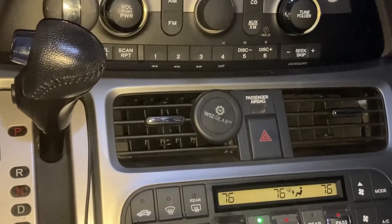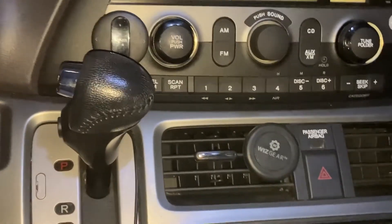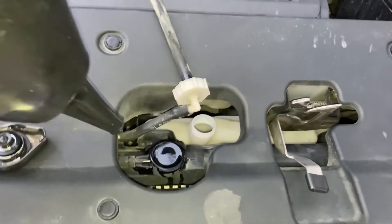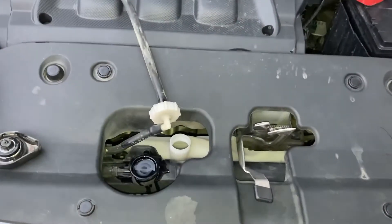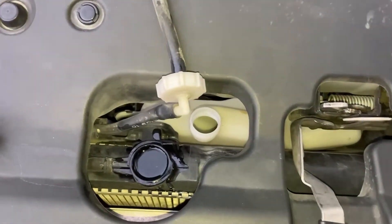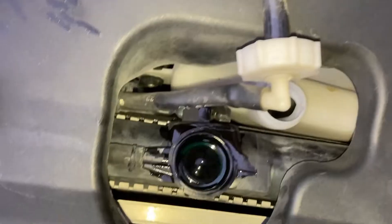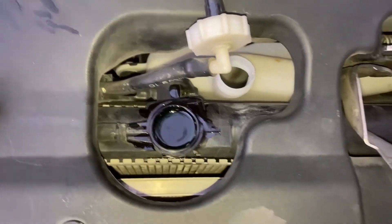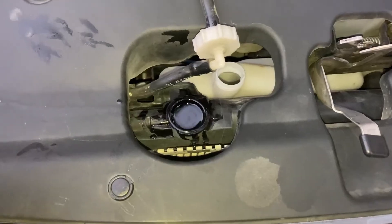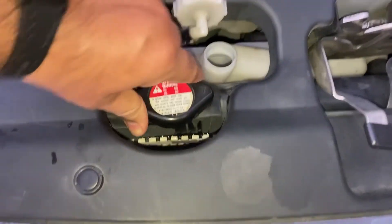Inside the vehicle I'm going to turn on the heat. You want the radiator fan to kick in. When I say burp the system, what I mean is: while the car is running, grab the radiator hose and press on it, and as I'm doing that we'll see the air bubbles come out. We'll do that a few times to make sure all the air bubbles are removed from the system. Then put the cap back on — I made a little bit of a mess, so we'll wash the vehicle.